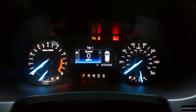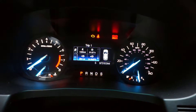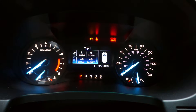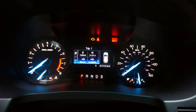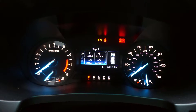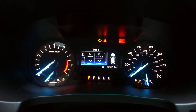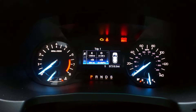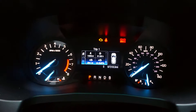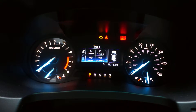I just did a 1,600 mile trip — 1,595 miles this week — with the ruthenium plugs. Going up and down a few mountain roads, performance with the iridium plugs at around 95,000 miles seemed pretty much the same. The idle does seem a lot smoother with the ruthenium plugs, but as far as acceleration everything else seemed the same. Average was 24.6 miles per gallon on the trip — showed about 25.6 on the trip down, and on the trip up it rained for about four or five hours.